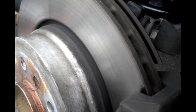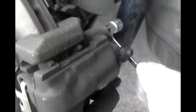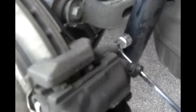So this is a neat trick that I like to do: let's see, this is a 6 millimeter, I believe. Let's see, nope, 8 millimeter Allen. And now I can use that to remove the slider. So I broke it free this way, and once it's loose, they usually come out pretty easily. Okay, there's my top slider.